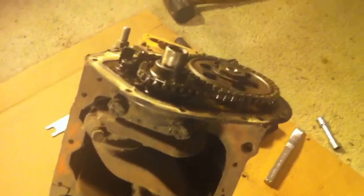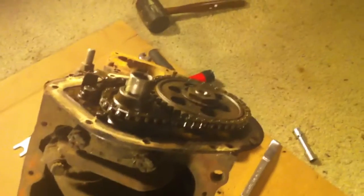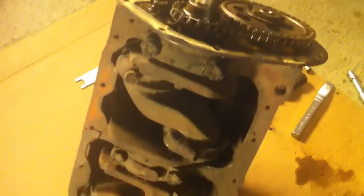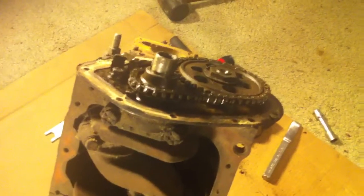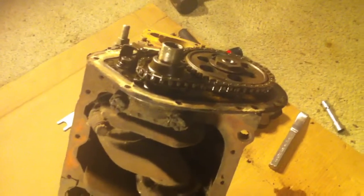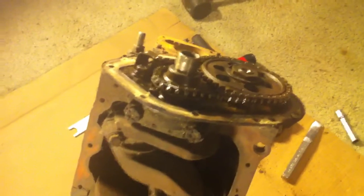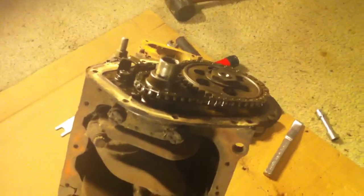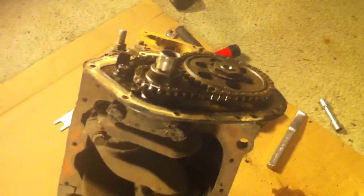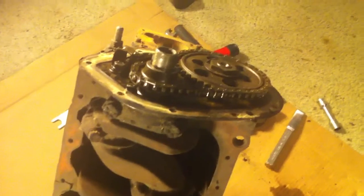And so we're going to carefully take this apart, and we're going to punch this block out just as big as we dare. And right now the math shows it being slightly bigger than an old 1071. If we go with 100 oversized pistons, we'll see what kind of rod combination we can come up with. That'll allow us to use a 1275 head directly on the block without notching. Allegedly, we'll see if the aluminum head, which is our plan, will work. It has further spaced valves, but we'll see if 100 thousandths oversize on the bore will allow that to work.